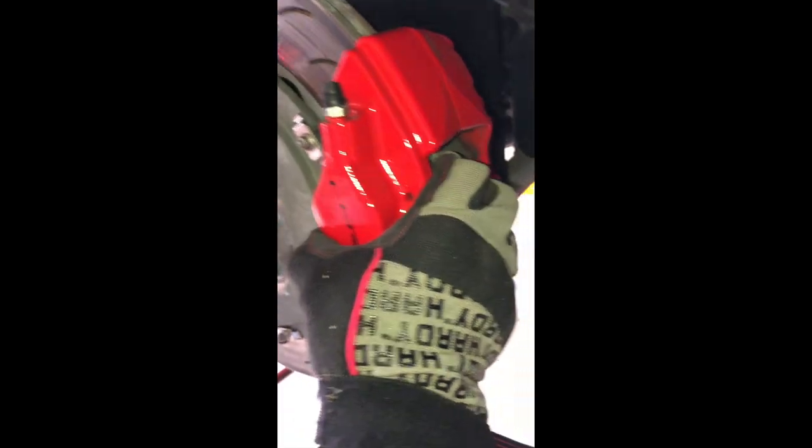This is where I would strongly recommend you go spend hundreds of dollars on some form of caliper compressor tool to keep the tool companies in business — or you can just squeeze really hard with your own hands like this. You're going to push in on these pistons and squeeze really hard. Push it hard on the top, push really hard on the bottom — you should feel the piston slowly move in and you should start to feel your pad get all floppy in there, and they should come right out.